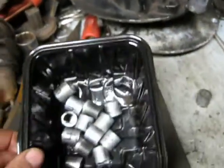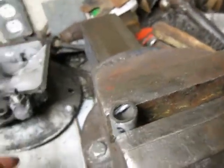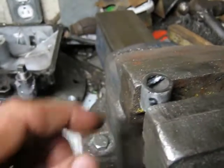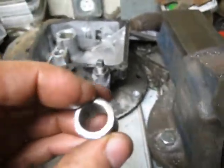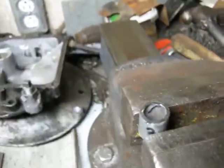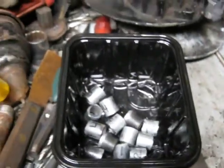I've got to do mass production here because I've got to make 15 of them. You've got to cut them to length — that's why I've got them marked. I cut them in groups of 3 and then sanded them off, and now I have to file them out. You've got to get all the burrs out on both ends. It's quite a lot of work, especially with 15 of them in mass production.